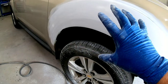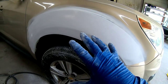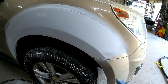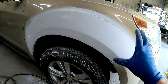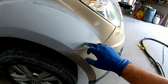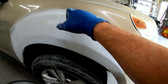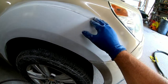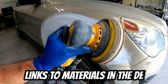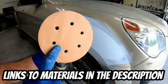Now that we have it all blocked and straight, I don't see any pin holes or anything we need to fill — you want to look for any pin holes or scratches that might show up under the paint or clear. Now we're going to go over this entire fender with 600 grit, machine sand these hard edges, and machine sand the primer around the rest since no body work was done there — just flatten it out and get it nice and smooth. We're going to use the orbital sander with the interface pad; this will curve to the contours of the panel with some Duragold 600.